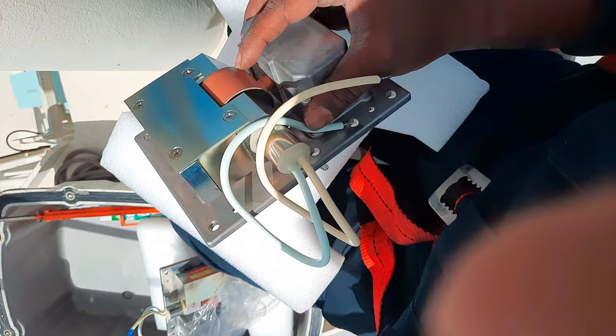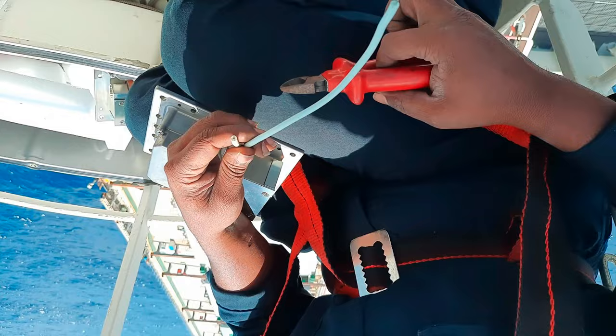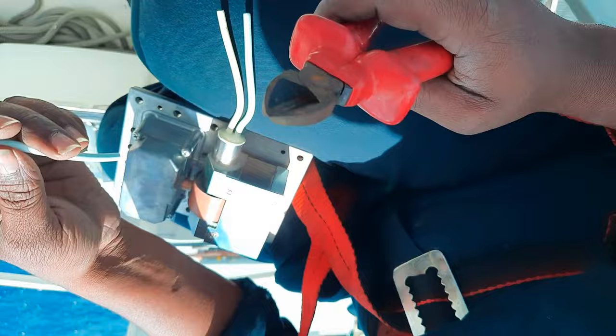Friends, please do take off your wristwatch while handling the new magnetron, as the strong magnetic field generated by the magnets can damage the gadget. You might need to adjust the cable links for the new magnetron — do cut them as required.